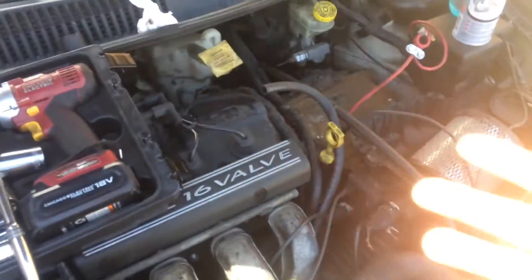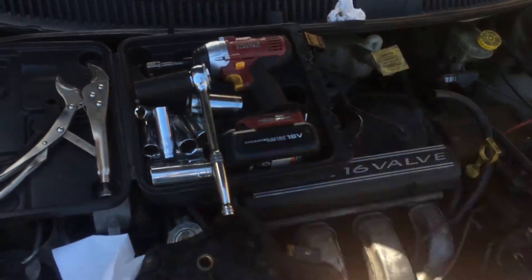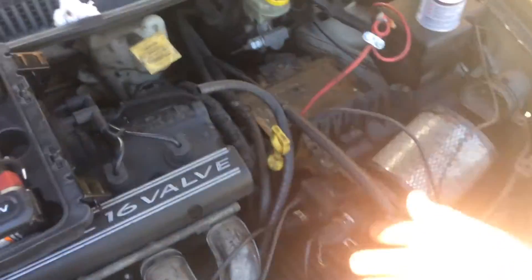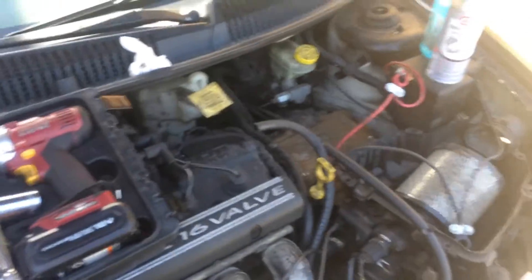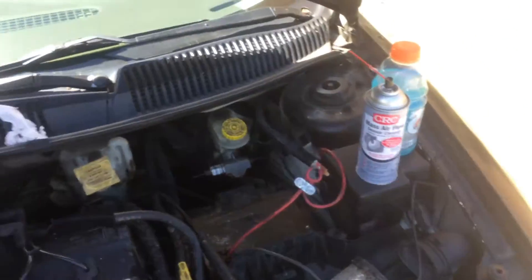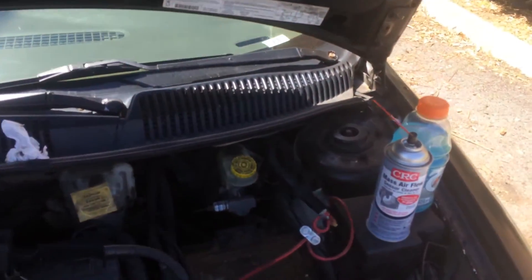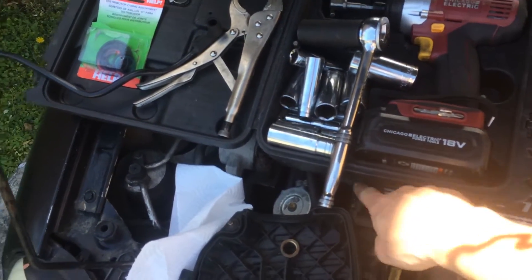But this is one of those videos where I'm doing one thing that can control rough idle — which is the PCV valve and leaking vacuum lines. So take care of that, and if that fixes it, then I know that was it. If not, I'll have to dive in deeper. My next thing is to tackle this crack in the fuel line.